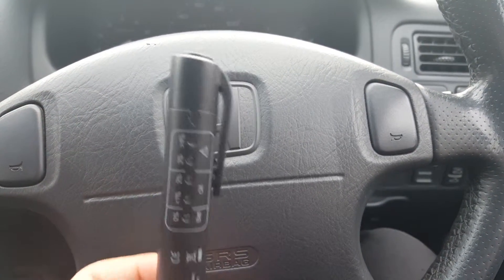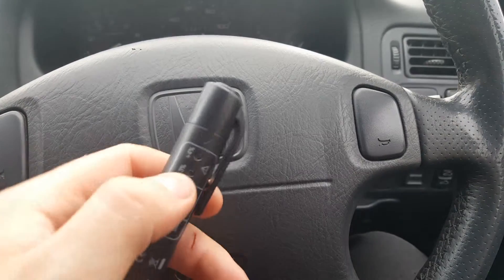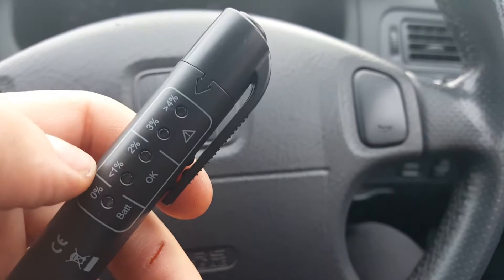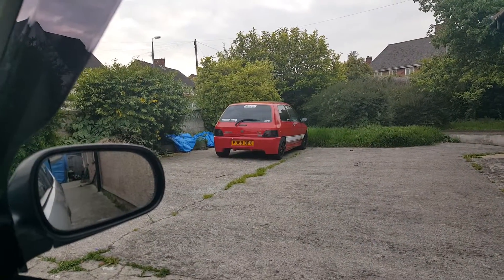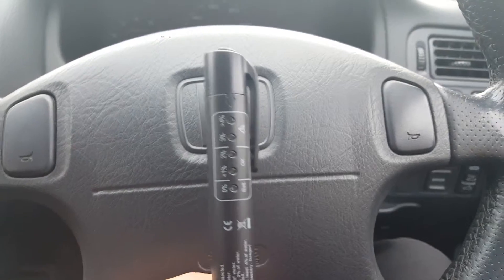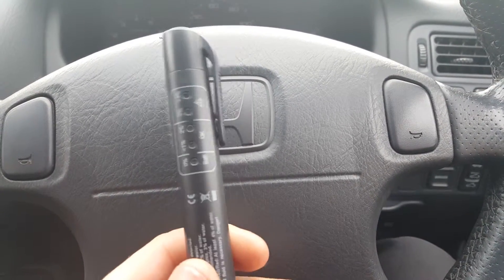This tool works on a light system — if you're in the first three you're okay, and if you're into the three percent and four percent it's time to change. Brake and clutch fluid is what's known as hygroscopic, which means it absorbs water, and that's why your clutch and brake fluid needs replacing when it gets old.